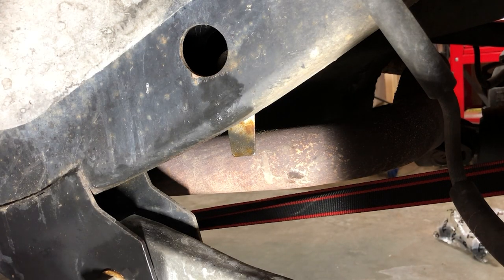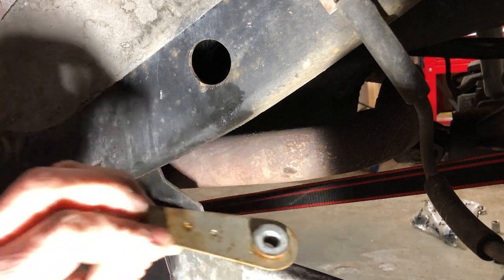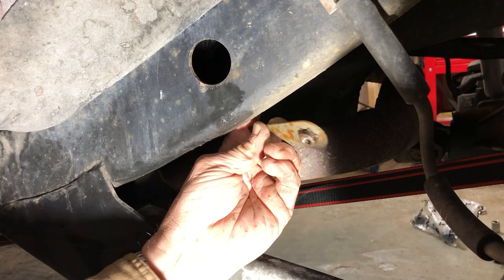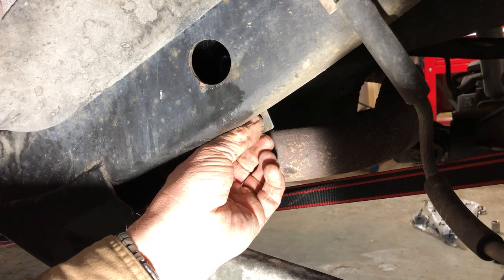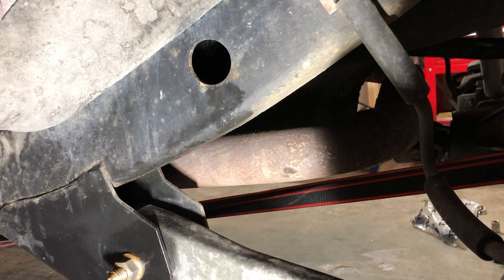And it doesn't look in terrible shape, but the bushing's definitely showing a little age, so we got the new one, we're gonna go ahead and use it. All right, one other thing I'll show you here is this little tab. That is the tabbed nut with the washer. So that's why we couldn't drive from this side. There is a little gap right here. The beauty is you can actually hold it there and then just thread the bolt on from the other side. So since we're here and we don't wanna have too many of these control arms loose at once, we're gonna go ahead and put in the new passenger upper.